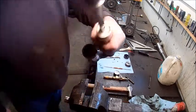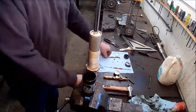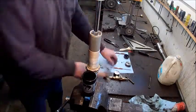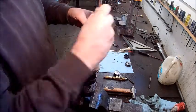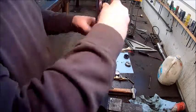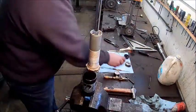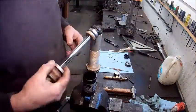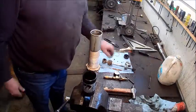And I don't know if you noticed, but when we took the reservoir cap out, there's a little wire ring in there. So here we're going to push the gland into the cylinder bore a little bit so we can get the ring out. Digging at the ring. Okay, there's a snap ring holding the rod in there. That'll pull right up out of there. This is standard shock stuff we've seen before.